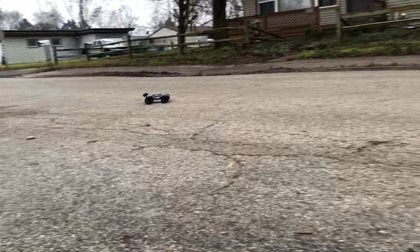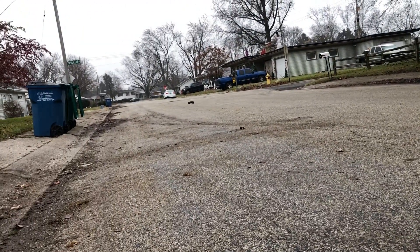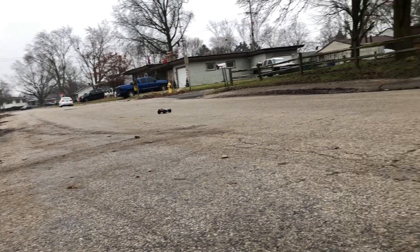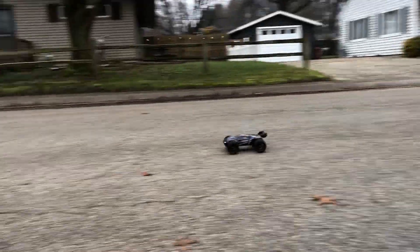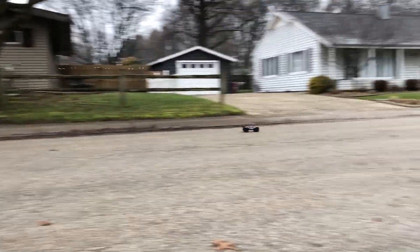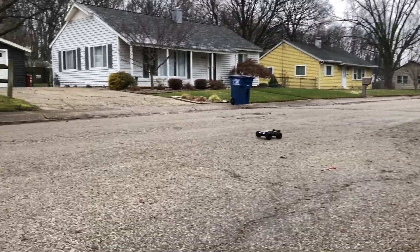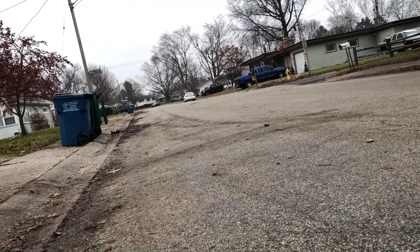It does have a little bit of cogging — that's probably because of the brushless motor, probably a little too high KV. But in brushed form it doesn't cog. Keep that in mind — mine is upgraded, so if you get it stock out of the box it's not gonna have that little jittering. You can notice it right there — that little jittering. But once it gets up to speed, this little thing is a ripper.